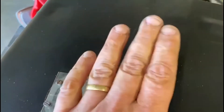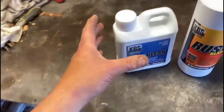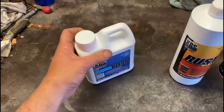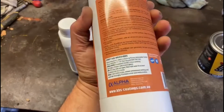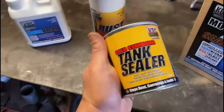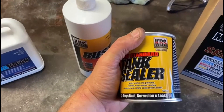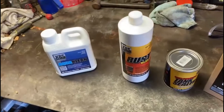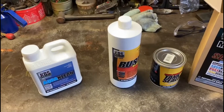We're about five litres short but that's fine. To prepare it, I sealed up the openings. Now we've got to mix the cleaner 50/50 with hot water, give that a rinse, then convert the rust with the rust blast - I'd say it'd be phosphoric acid but it doesn't say. Then when it's all dry, we tip the whole lot of sealer in - no stirring required apparently - swirl it around until you get a nice thin even coat over the whole tank and let it dry.